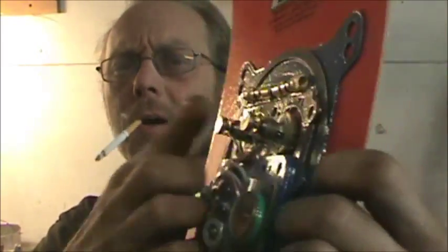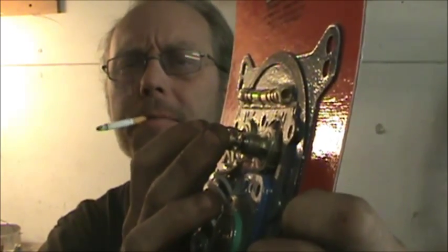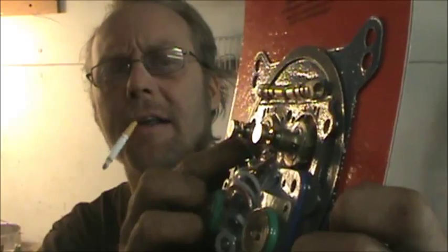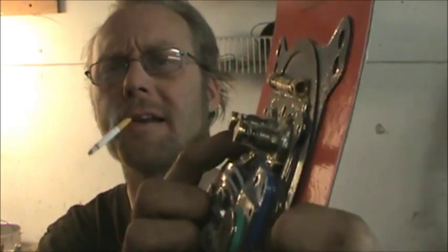These right here are called power valves. You get a good backfire, generally you're gonna blow them out. They've got a diaphragm down inside and they work very similar to an automotive thermostat. You blow that diaphragm inside and it allows unregulated fuel at inappropriate times.